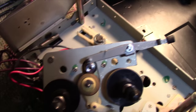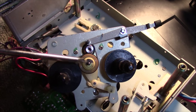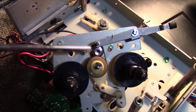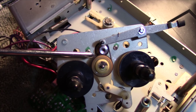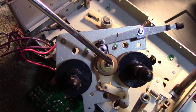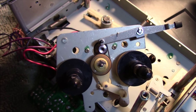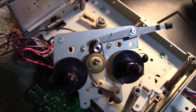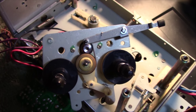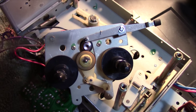Now you can see that traction tire I was talking about — that's going to have to be replaced. I'm also going to have to lubricate this pulley. The motor rides on that traction tire and this arm swings and pivots between two reels. As much work as this all is, best to replace the tire rather than try to clean it. I'm going to put an order in and see if I can find a traction tire.